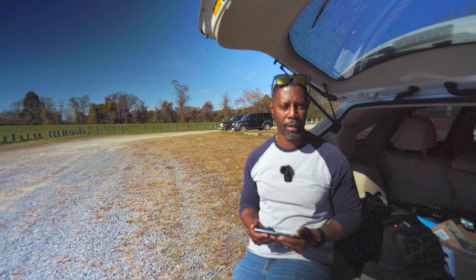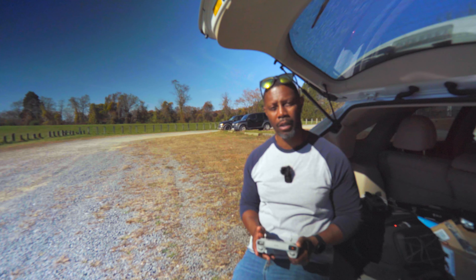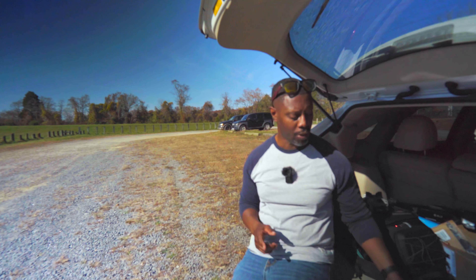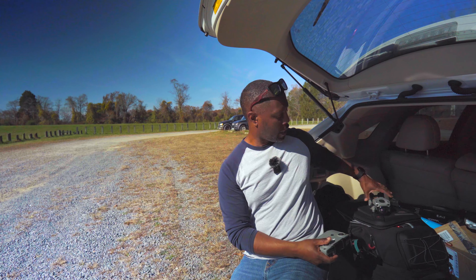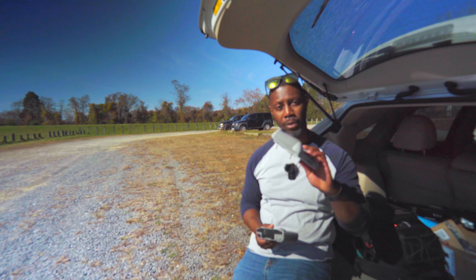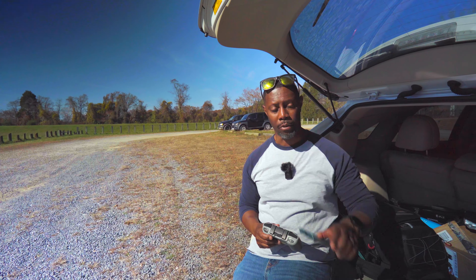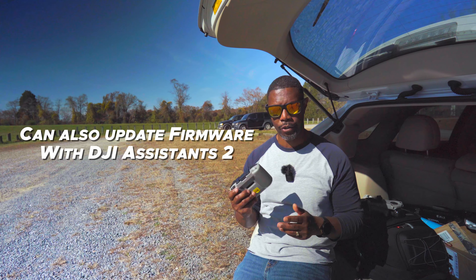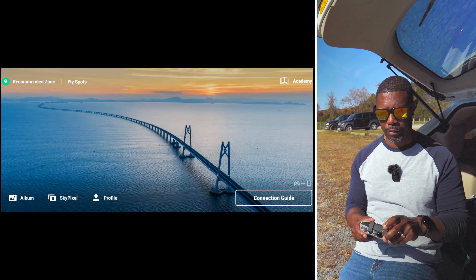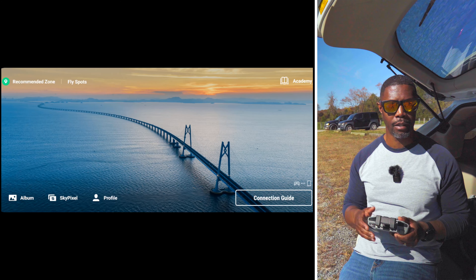Go ahead and wait for that to download. If you try to connect to your aircraft, it won't work because the firmware updates aren't compatible yet. So you will have to update the Air 2S. In order to do that, you will have to use the old remote with your cell phone. Connect your phone to it, turn on the remote, turn on your aircraft, and it should pop up with a firmware update — or you can go through the same steps and check for firmware updates manually.